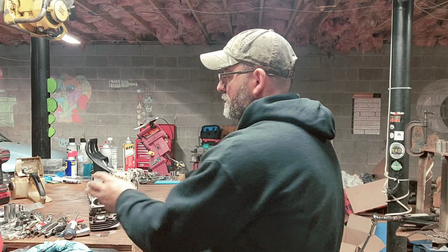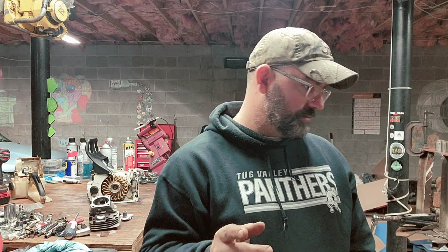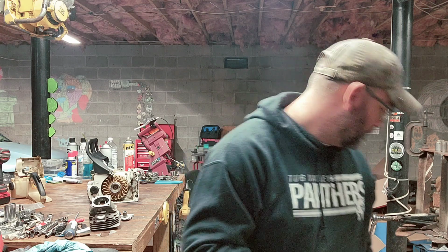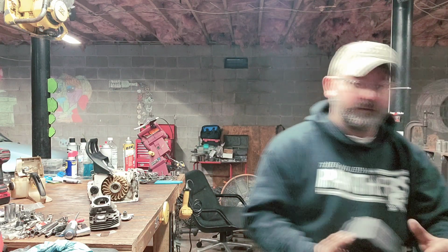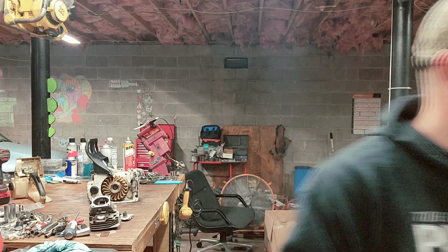let me set this down. Let me show you guys an exhaust. I do have one. Well, let's see. Okay. Let's say that this is that exhaust. Well, you got a port over here that's got the screen in it, but there's not much room on this side to actually put another port. So what I did was I went down here on this front part and I drilled a hole. There was already a dimple like this in it, so all I did was drill it out, and it's going to be perfect for those press-on prefab outlets that I got.